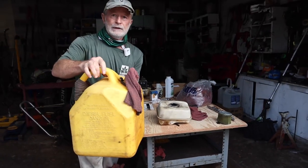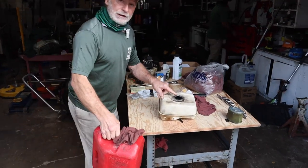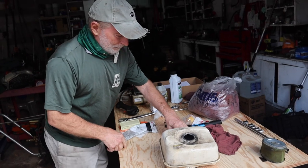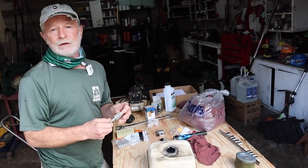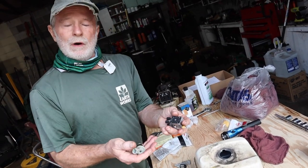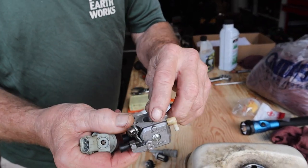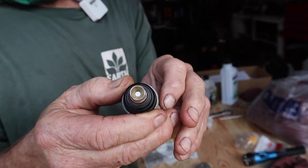This is a diesel tank over here, and this is your two-stroke tank. When you take this lid off, this is what happens — dirt transfers from the can into your tank, and from there it goes into a filter. The filter is either inside your tank or outside your apparatus. No matter which apparatus you're using — a chainsaw, a lawnmower, or even your car — they've gone from these filters here to what they call injectors or carburetors. These are what make your engines run. The orifices are really tiny in the carburetor, so a grain of sand can stop things up. As we move to fuel injection for better fuel economy, we're using even smaller orifice holes, and they will clog up — then you wonder why your engine doesn't run.